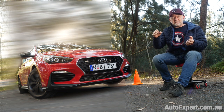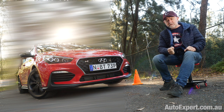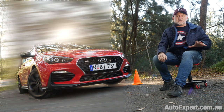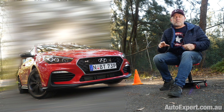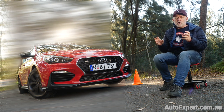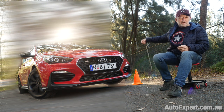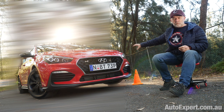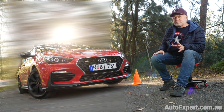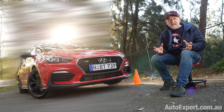So it's looking at, for example, the speed of the car and the steering angle position and the throttle position and what gear you're in and how much power you're feeding into the powertrain at this point in time. And then it's making a whole bunch of intelligent decisions about how much to clamp this inside left-hand drive shaft to constrain that wheel spin. And when that wheel spin is constrained, some really mad physics things happen.